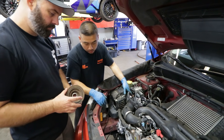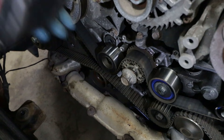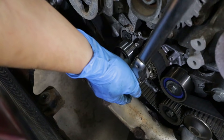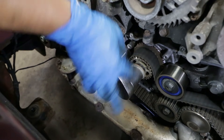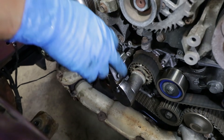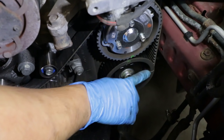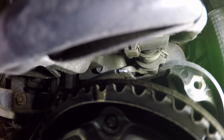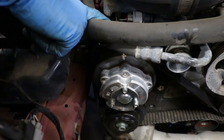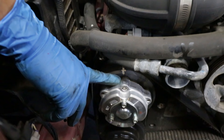The next step is to line up the timing marks. We're going to reinstall the crank bolt, tighten it back up, give it a zap to get it in place, then use a breaker bar to crank it so we can line up the marks. This mark right here is going to line up to the notch on the oil pump. Once that's lined up, we've got to double-check that the marks on the cams are lined up — the double mark here should line up, and these marks should line up to the cover on both sides. This one's hard to see — you've got to grab it with the mirror. There's a mark on the upper timing cover, and the mark on the cam has to line up to it.